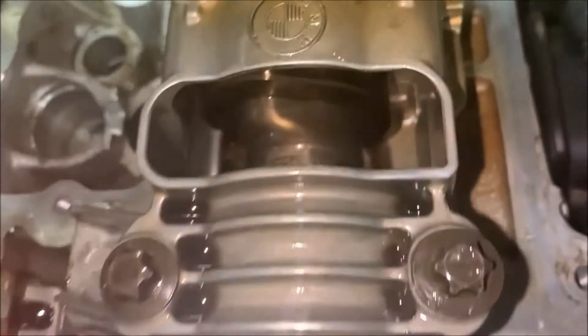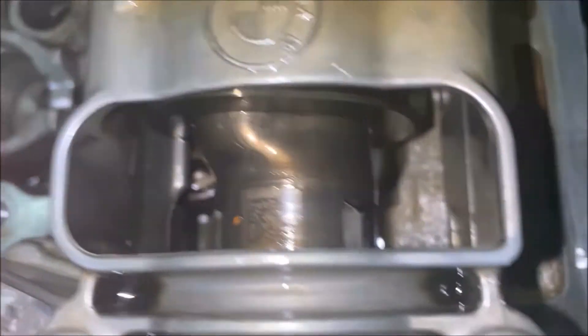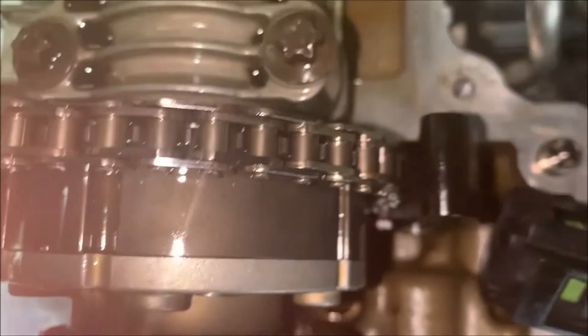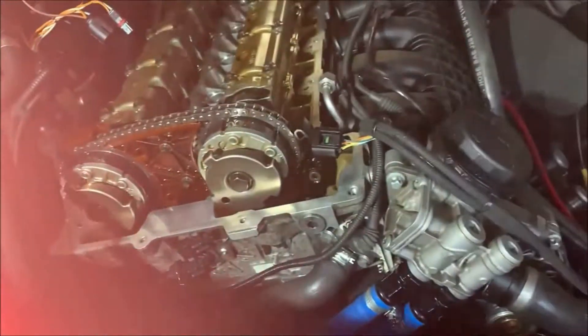Once it's there we can check if the cams are significantly out of time. You'll see these QR marks stamped on the top of the cams — they should both be pointing dead straight up. These forks on the tool should be able to slot in to confirm we're in time. But looking at it now, those cams look slightly off to me on both sides, so that hopefully is my problem.